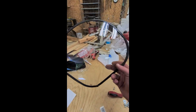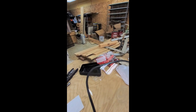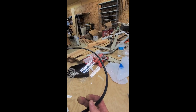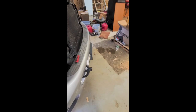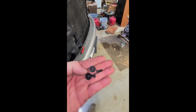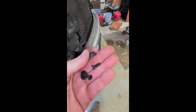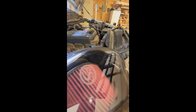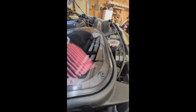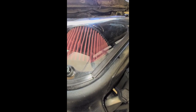And voilà! I did have to cut a chunk off of it, but I'm going to wipe it down with some spirits or something — trying not to get it on the plastic because it will haze it, but I want the seal as clean as possible. For the plastic they give you these screws and these concave washers that fit pretty well. I ended up using water to wipe down the seal instead — I didn't want to chance it. Then I noticed this gap, so before I tighten it I'm going to pull them tight; I should have done that on the straight edge first.